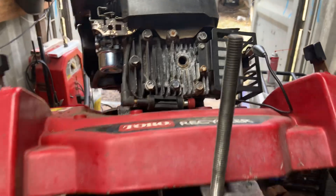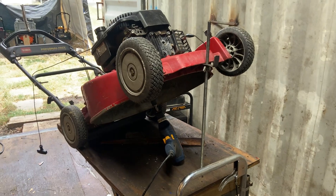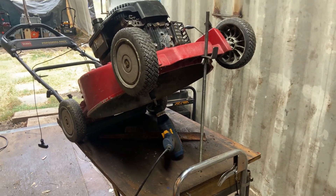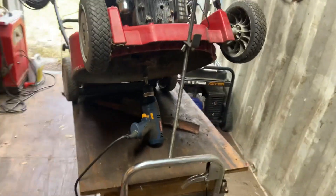But now I know that I need to take all this off and it won't be a waste of time, because I've got a problem with no spark anyway. That's my little video for today — just showing you how to check spark on a push mower when you work alone. It only takes a few minutes: jack it up, pull the blade off, put the bolt back in, tie the bail down, spin it, check for spark, you're done. Get on with your life — catch you later.